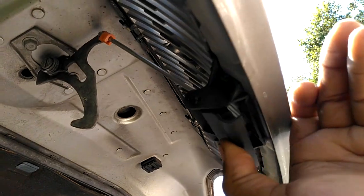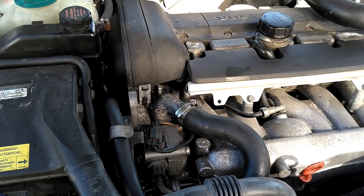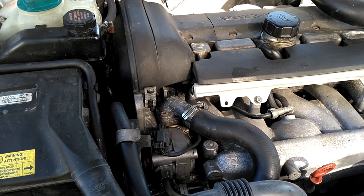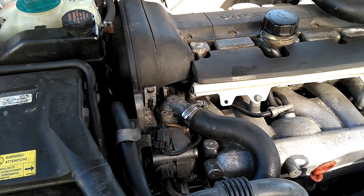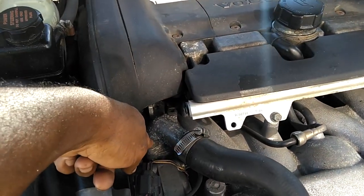As you can see it lifts the rod up to release the hood release. So if yours breaks you've got to get that rod lifted up and it'll release the hood. In this video I'm going to be replacing the thermostat on this C70 Volvo. This is the P80 platform car — 850s, S and V70s. This probably applies to the 900 series cars as well. They have a thermostat housing up like this.